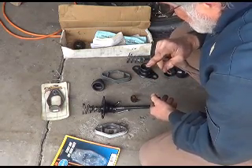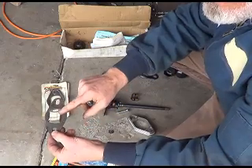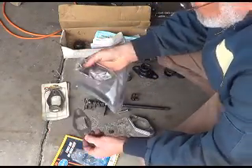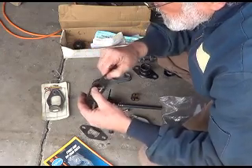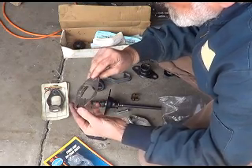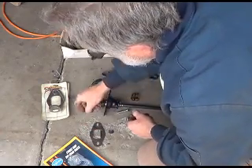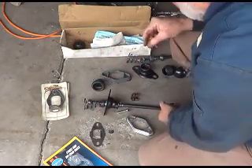Let's get the one out of the car and put this one in just like I described. This part goes to the front of the car, the long side goes on the passenger side and it kind of curves up. I found a plate in the Baja when I first got it that did not have the little ramp on the left side — it doesn't look like it was cut off, just missing. I'm not that much of an expert on every year that was ever made, so I'm just showing you what I have experience with. Clean your stuff up, put a light coating of grease on it, then we'll put it in and adjust it.